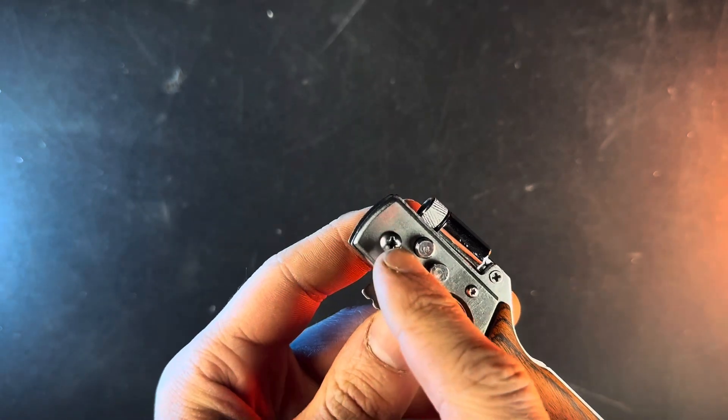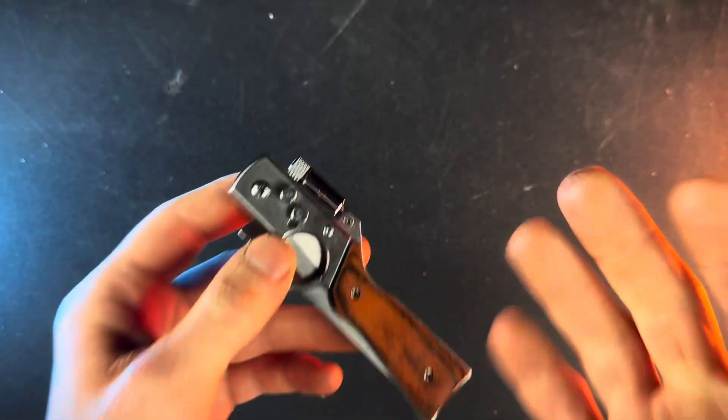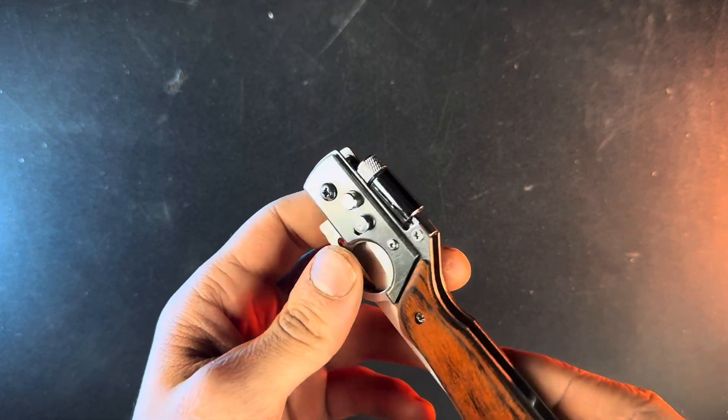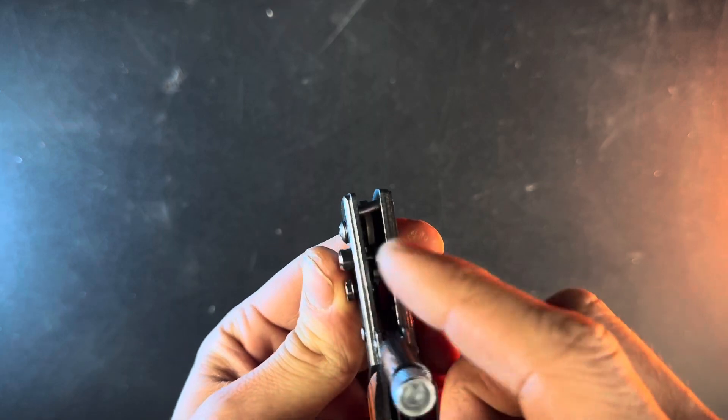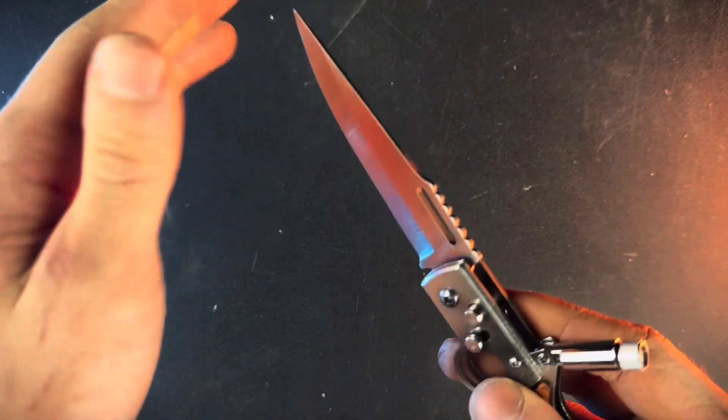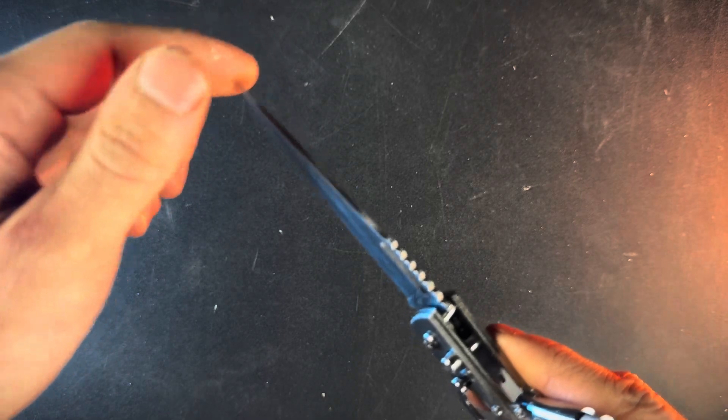This could have just been overlooked in the one I got, but this screw here doesn't have any loctite on it, so after flipping it for a while it might come undone — which is exactly what happened to me. That caused this pin here to come out of its socket, and since the two pieces came apart a bit, the blade became really wiggly.